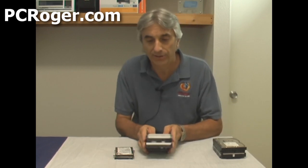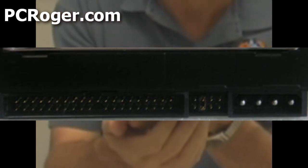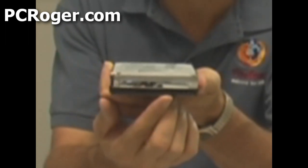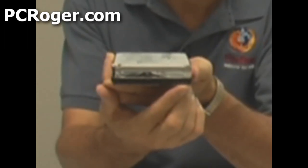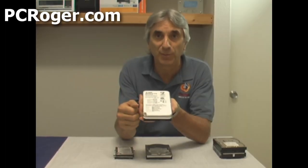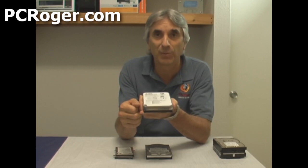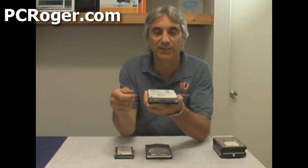These drives here are workstation drives. Over here we have three-and-a-half-inch hard drives. The one on top is the standard ribbon cable IDE with the plug, some jumper pins, and the power connector. The jumper pin code is right here on a sticker on the drive — not always, but often. If it's not there, hop over to Google, put in the model number, and see if you can find the pin information.